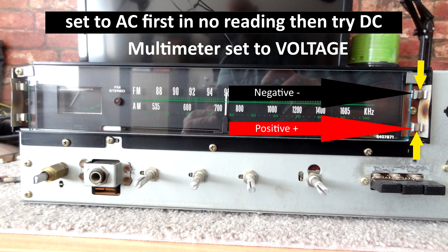A third way, if you've come unstuck with both those methods — you haven't got it on the side and you haven't got the circuit diagram — is with a meter. Just where the old bulb is, put the probes of your meter. If you haven't got a meter, you can pick up a cheap multimeter for about eight pounds. Put it on volts, start off with AC, turn your unit on. You'll have to have your unit plugged in for this — plug it in and check the voltage across the two connections. Try AC first; most bulbs are AC. You should get a reading between maybe six and twelve volts. If not, switch the meter to DC and you should get a reading there.